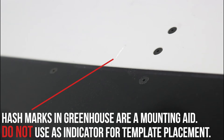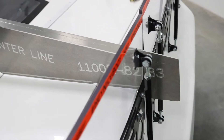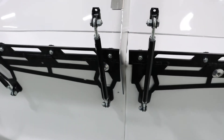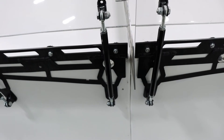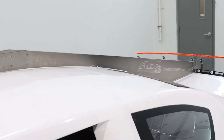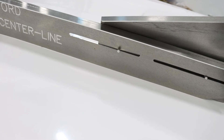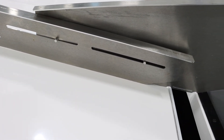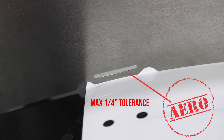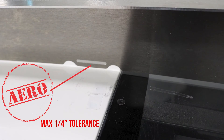The hash marks are not to be used to indicate template location. The rear of the body center line template rests on the hump at the seam of the bumper cover between the split and the spoiler. This template controls the front-to-rear shape of the roof, correct height of the windshield and rear window, the correct shape of the deck lid area from the base of the rear window to the spoiler, and the correct shape of the cowl area and rear of the hood. The front and rear of the roof are aero-sensitive areas as indicated by the hash marks; the tolerance is a maximum quarter inch versus the maximum half inch along the remainder of the template.